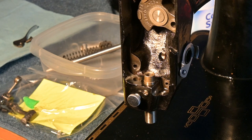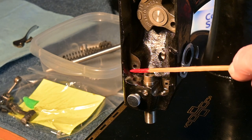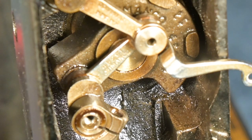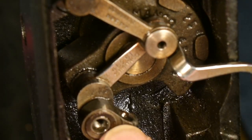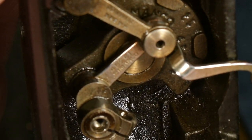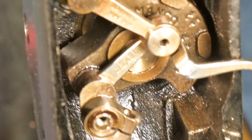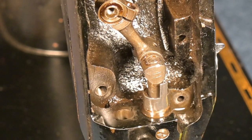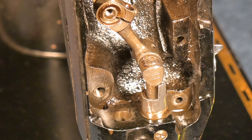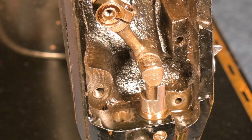That up there in the corner, that's about the only thing I can use it for. Where I'm at now is I was able to get the presser bar and its associated gear out of the nose. I was also able to remove the needle bar and its associated two or three linkages, and they've all been put away in an organized fashion, so that when it comes time to put this stuff back together, I have an idea what part belongs where, or what screw really belongs with what part, more concisely. But this has all been cleaned. The issue now is that there's a very difficult set screw that is holding this counterweight onto this end of the horizontal arm shaft. And that's the end of the horizontal arm shaft right there.